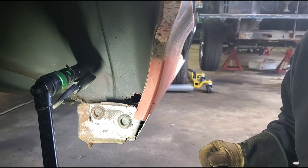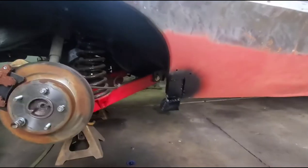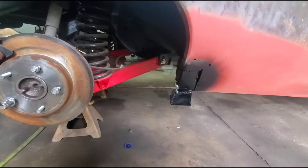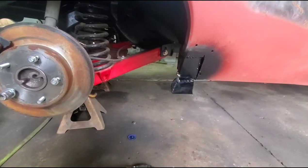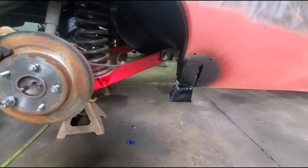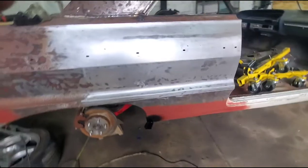What took a second for you was about an hour or two for me. The inner rocker extension piece is now made and welded in from the back side. This is the outer piece that welds over it for the quarter panel — I had tacked it on to make sure everything was good, then cut the welds, peeled it back, and primed and painted everything inside so it doesn't rust. Now I'm going to flip this up and do the final welding to close up that quarter section.